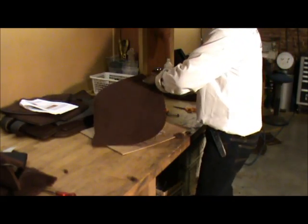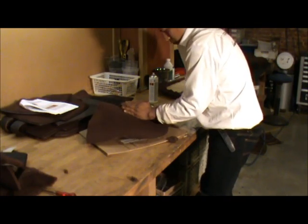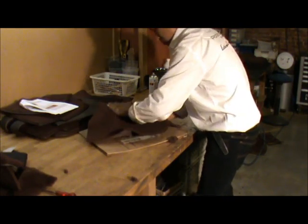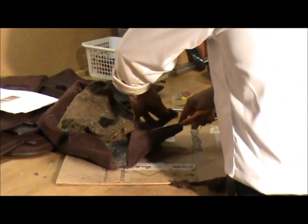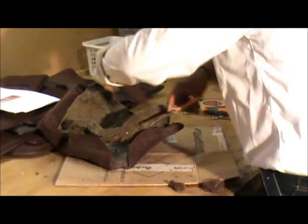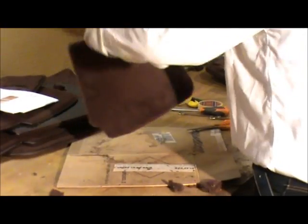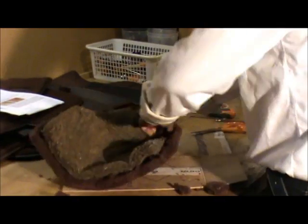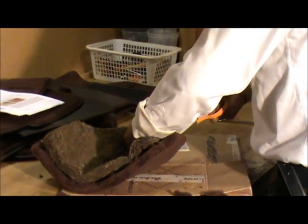Now he's not going to go too hard on the bond because he wants to make sure that he's got everything positioned from the middle, and then slides his hand across to follow the curves of the panel. Don't worry too much about the sound deadening material that's inside the cover. You can simply fold it up a little bit to make place for gluing the carpet around the edge. It can be very easily glued back later.